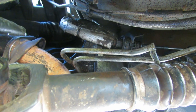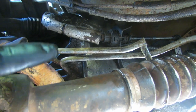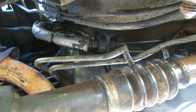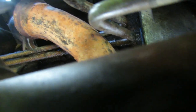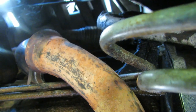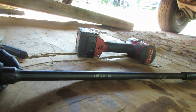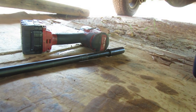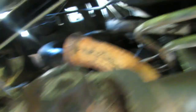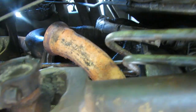I might have to loosen up the exhaust flange bolts to get a little more wiggle room because this bend right here is really causing an issue. I went ahead and got the flange off — that was 9/16 on both sides. I used an 18-inch impact extension with the impact gun and the 9/16 deep well, and then pried the pipe off the flange so I can get these pipes up and around.